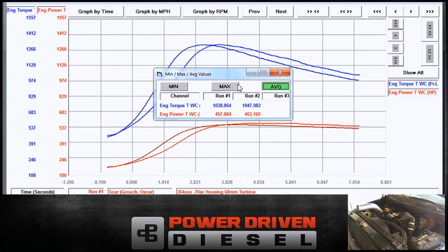That could simply be a hotter part of the day — if we'd tested the 64 in the morning it may have been a tie. The 62 is going to come on quicker, but the 64 may hold it out longer. Basically, I'd say this is almost a tie, which isn't too surprising because they have the same turbine side. The .70 housing and 68mm wheel is kind of small for these turbos, but it yields a really good spool-up — you're compromising with that small housing. If you want the .70 64, it's a good spooling turbo that holds peak power a little better; the 62 comes on quicker. Depending on your goals, you may want the 62 or the 64. If you have any questions, call us at Power Driven Diesel at 435-962-9555, or go to PowerDrivenDiesel.com. Thanks.